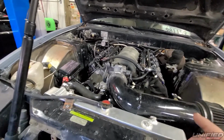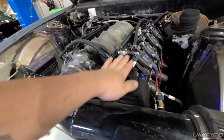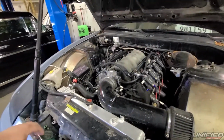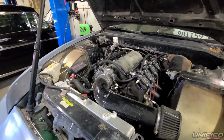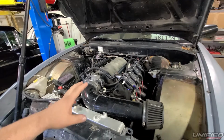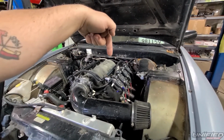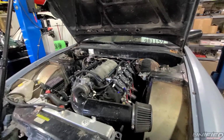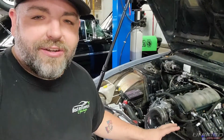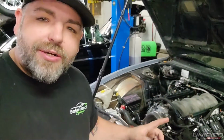They pulled out the LM7 camshaft, down inside there, because there are no cams up here, all down there, the way it's intended. Sorry, I had to take my dig at my Hyundai buddies over here. But the factory camshaft is around 190 and 191 on the duration, and around 460 on the lift for both of them. Not very good. The new camshaft that's in here is a 230, 235 with just under 600 lift on there.